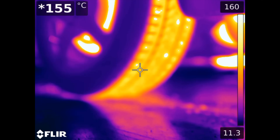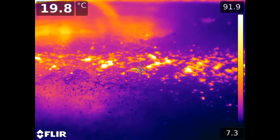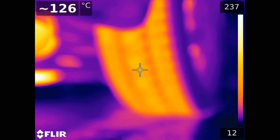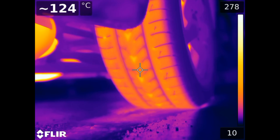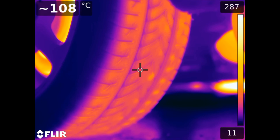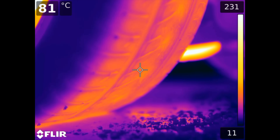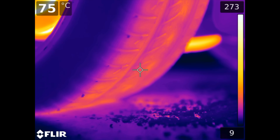After the fact, the tires are roasting over 160 degrees Celsius. The tires do cool off fairly quickly, however. At 45 seconds after the burnout, the temperatures have dropped to 125 Celsius. By a minute, the left tire is just over 100 Celsius. At a minute and 45 seconds, we're down to about 90, and by two minutes, portions of the tire have dropped below 80.